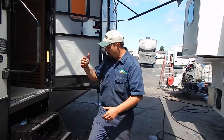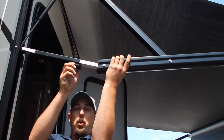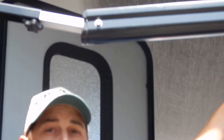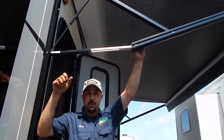If you do bring the awning out in the rain, to save your awning simply come up to one of the arms on either side, reach down, pull this down, and lock the screw into position. This tilts the awning in one direction or the other so water will run right off. Before putting the awning away, you will want to put the arm back into the fully extended position.